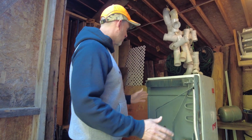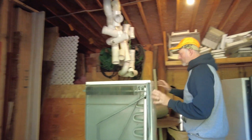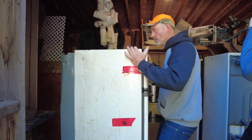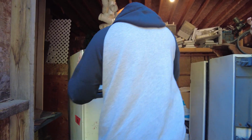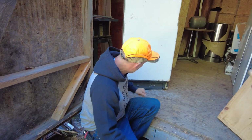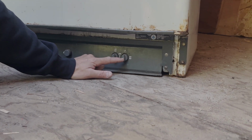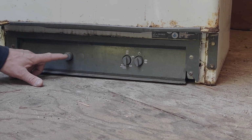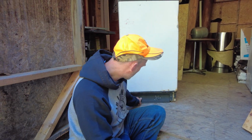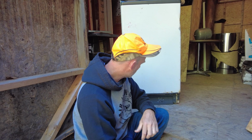So I'm going to teach you guys all about propane fridges right now, and let's just look at the front of this guy right here. On the front of this guy, down at the bottom, you get 3 controls, okay? You have a primer, you have a climate control, and you have a sparker. Now usually we light the fridges by hand, but originally from the factory the sparkers worked, and some of them probably still do.